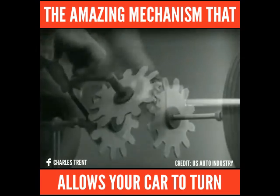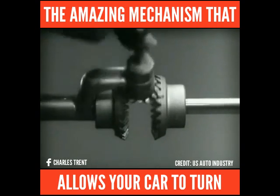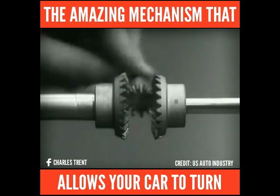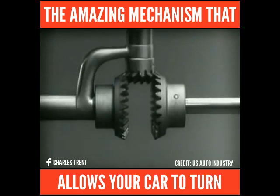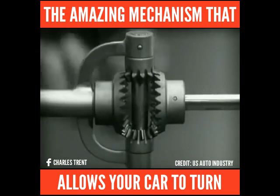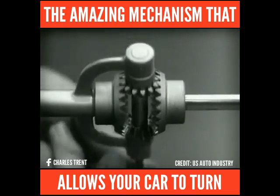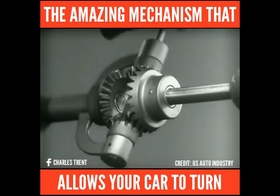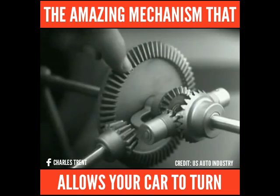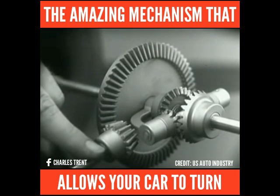Now, we can make the gears thicker and stronger, and we have differential gears. The edges are cut so that they will fit together more smoothly and silently. And, another gear is added to share the work of driving the axles. The principle is the same. In order to turn the support and drive the wheels, we can fasten a large gear here, connected by a smaller gear to a source of power.